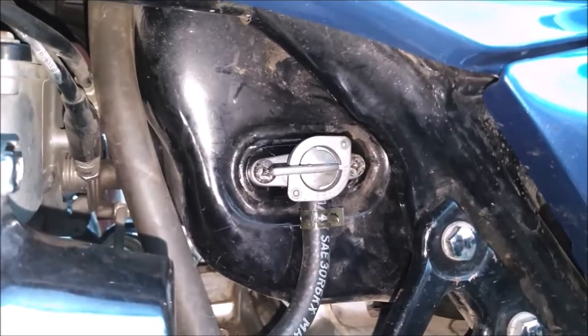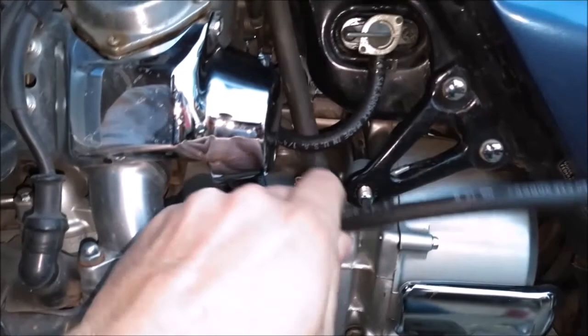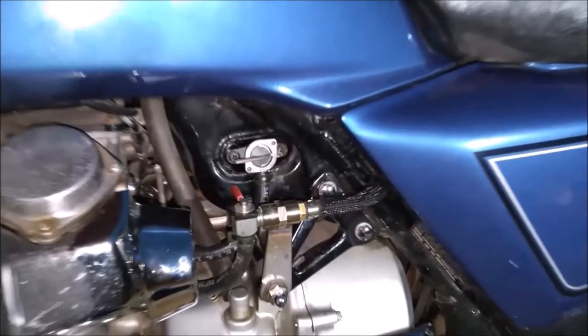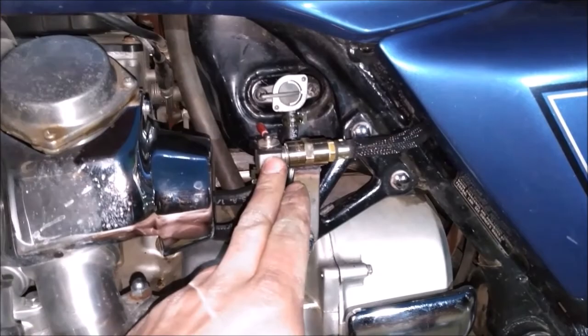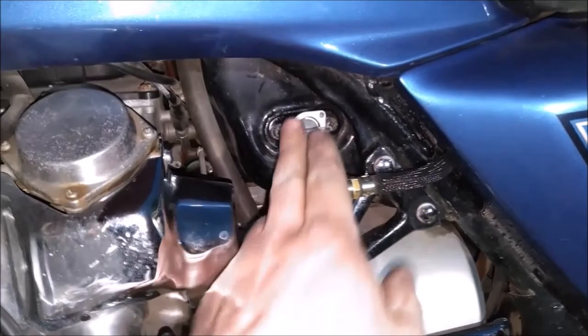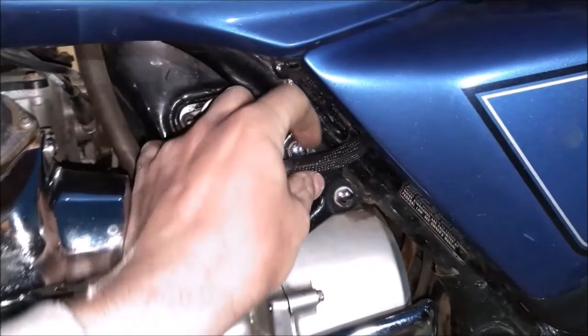About 45 minutes later and it hasn't leaked a drop. I've got new hoses running to the Y fitting back there, new hose running to a new filter to the fuel pump. This hose is going to go up here to a shut-off, and that's what I'm building a bracket for right now. There it is — pretty simple. I have the bracket in, I have the shut-off for the aux tank in the off position, the main tank is also in the off position. This is out of my 1000 GoldWing — both lines run to a Y fitting, into a filter, into the pump.